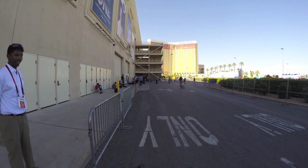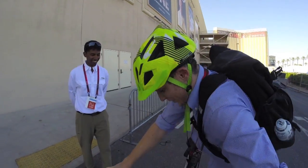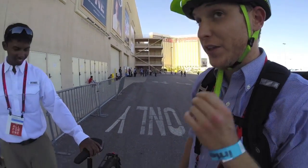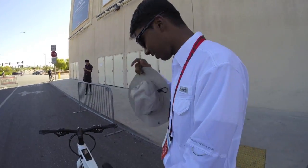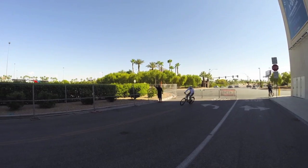It behaves like a geared motor even though it's a gearless motor — I've never seen a gearless motor behave this way. It's very torquey. Chanley's feedback: he wants one. On the brakes, he felt it quit quickly with his pedaling — it's a torque sensor plus all the other sensors working together. When he braked, he still felt the motor going a little, but thinks it's just speed momentum from the direct-drive system.